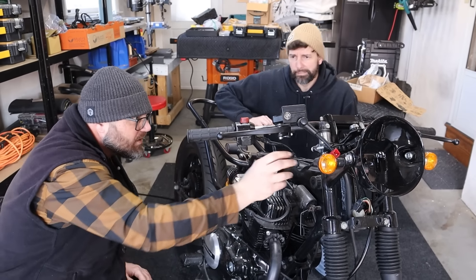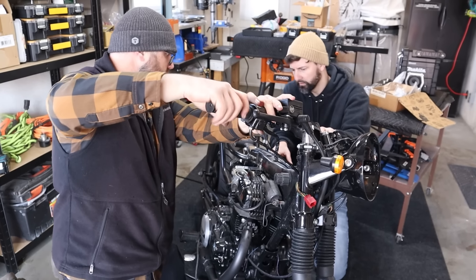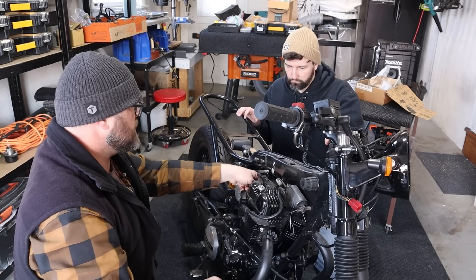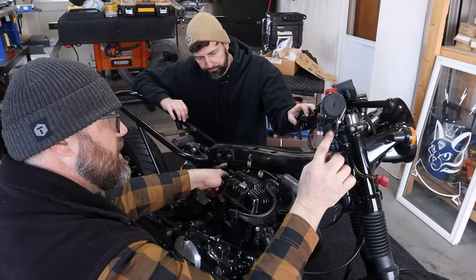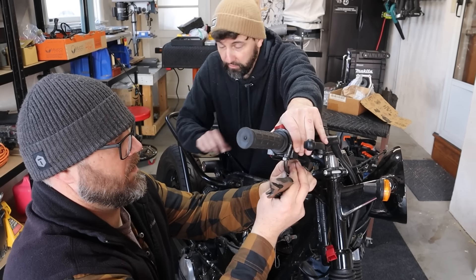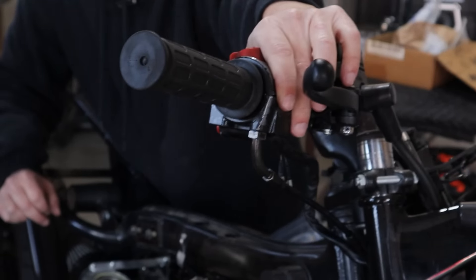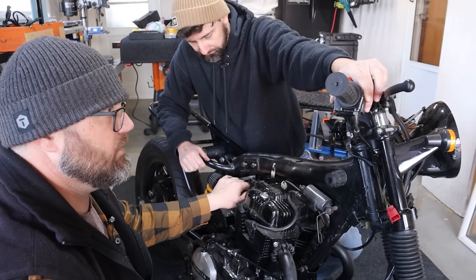How do we like that cable routing? As long as it doesn't catch on anything, I'm okay with it. So we need to tighten this down fully. We can tighten that up one of two ways — big adjustments are down here, more finite adjustment is here with this. This is just a lock nut that backs off and then you unscrew this a little bit for a more finite adjustment. That's something you just taught me — I wasn't aware this was a micro adjustment spot. I knew about the adjustment down here but assumed this was just part of the strain relief. I always like to get them close down here and then bring it in to final with the smaller adjustment. I think we have throttle cable.